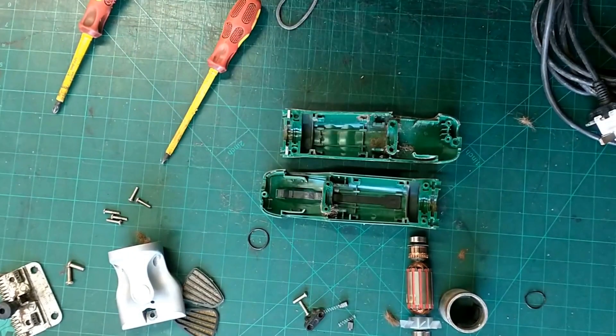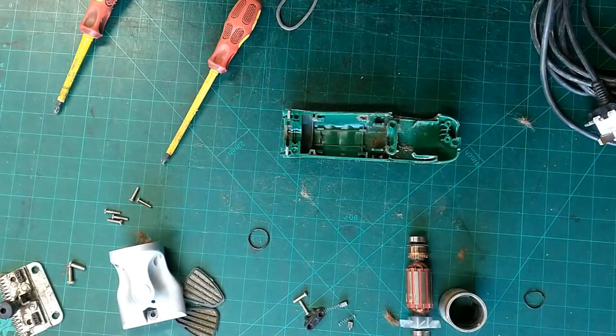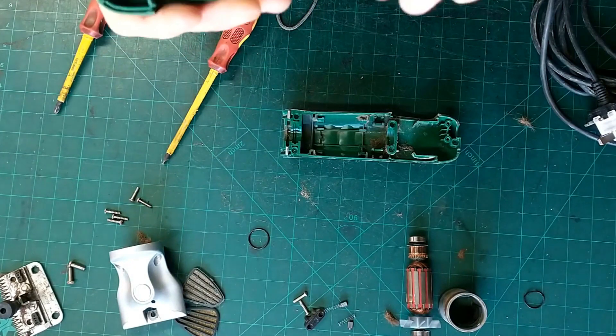So this is that O-ring that was caught — if we look at the state of that, I can see that's quite badly damaged. So it's not going to do what it should do — I'll replace that one. One at the front — that's what it should look like. Let's have a look at the two together: that's what they should look like, and this is what that damaged one looks like. So we'll replace one of them. The magnetic casing should all come apart — they're all nice and solid, so we'll give that a clean-up. That bearing feels good, that bearing feels good. So all of that is pretty much as it should be — it's just a little bit dirty, a little bit dusty. And we've just got to figure out what's going on with this switch as to why it's not doing it.